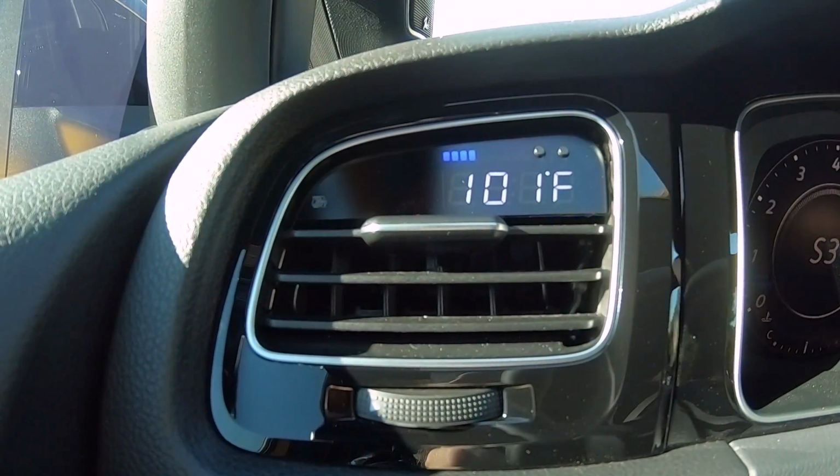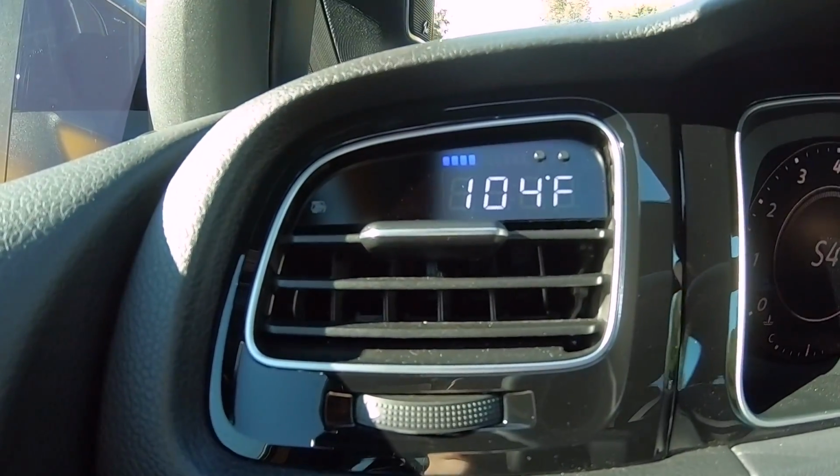Now, when we compare full throttle, giving it all she's got, the max on the gauge that I saw in the car for both of them was about 107 degrees. So does that mean that under wide open throttle, we're really not seeing that much of a difference in intake air temperature between the aftermarket and the stock one? Does that mean that our charge cooler is doing about the same job, even though perhaps the air coming in is a bit warmer? Doesn't mean that none of this even matters, and if you want to put an intake on your car, put an intake on your car.